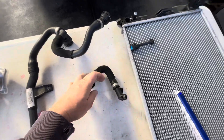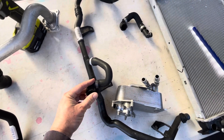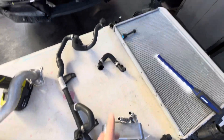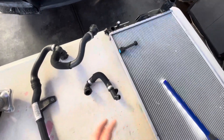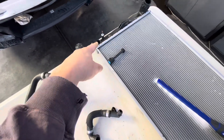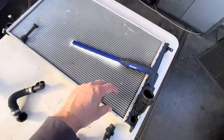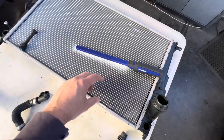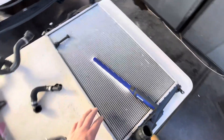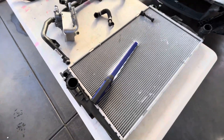What BMS supply is an anodized aluminium plug that goes in here and blocks the flow out of this line, and another aluminium plug that goes in this side to seal off that side. Those are the two connections that go onto the heat exchanger on the outlet side of the radiator. With those plugs in place, you're effectively blocking the flow from coming out of this hole, trapping coolant that will fill up but won't be moving — meaning you've lost the cooling capacity of all those tubes.